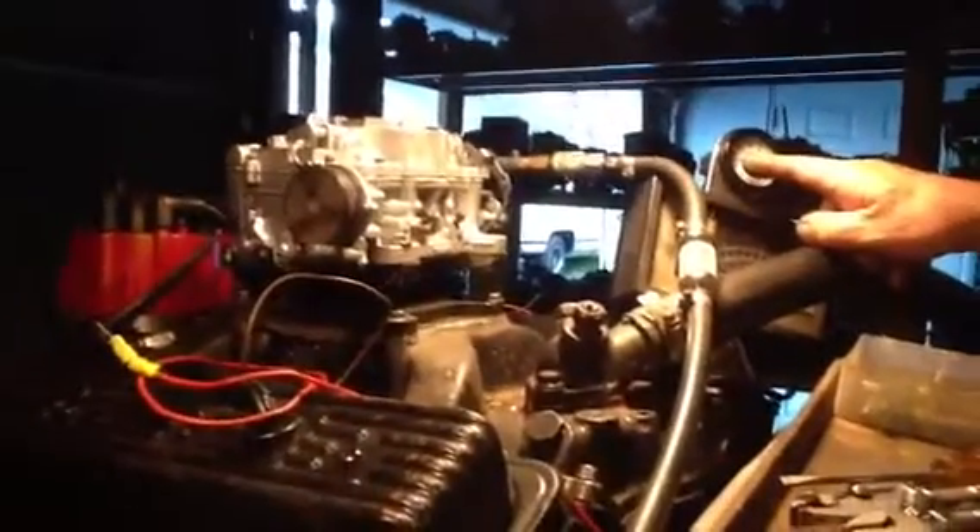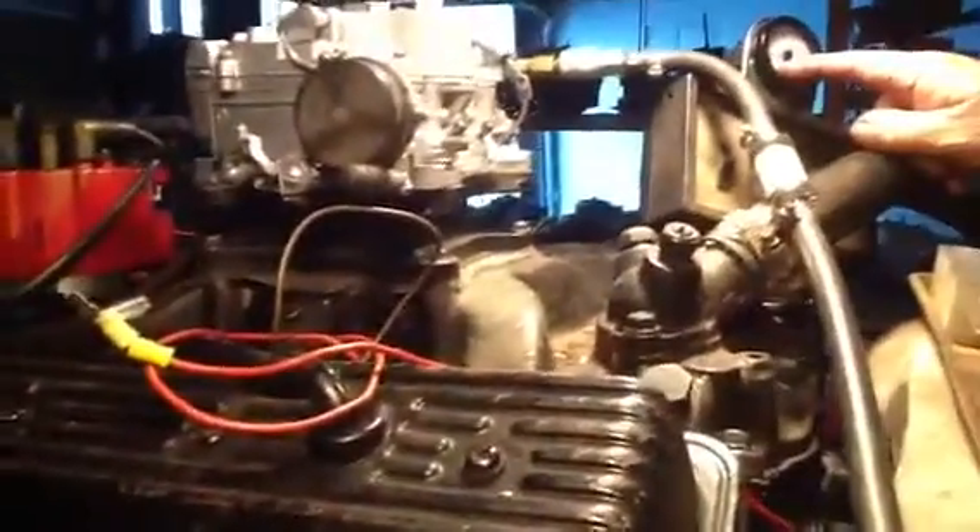3 pounds pressure — increase to 9, or jack it up as high as you can. No matter what you do, you cannot run this carburetor with unleaded fuel or alcohol-based fuel without a regulator. It will not work.